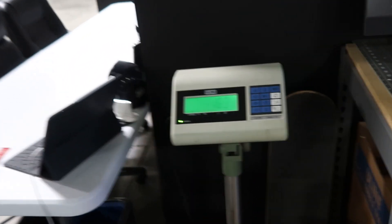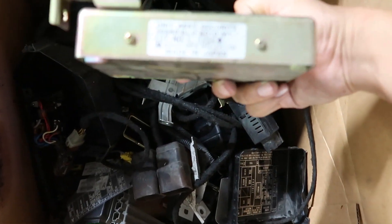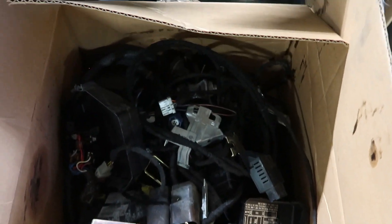Let's take a look at some of that wiring. I've taken quite a bit of stuff out of the car — unfortunately I didn't weigh all of it, but I'll give you a total weight at the end. The weight of the wiring was pretty interesting. This is our first box: 16.3 pounds. As you can see, we have fuse boxes and a couple of miscellaneous modules — I believe one was for the immobilizer anti-theft unit, so you needed that for the car to start. Then we've got this far larger box with all of the connectors for the chassis and everything inside the cabin and the front. Adding that to it: 56 pounds total. That is an absolutely massive amount of weight.